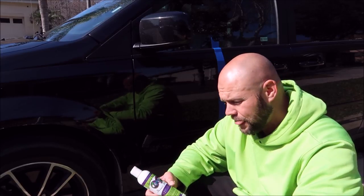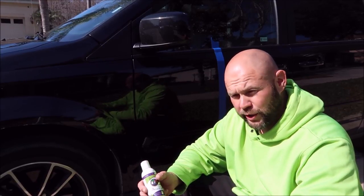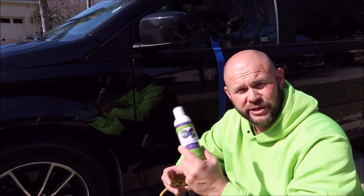It is awesome. Not only will you get decent cut and amazing finish, but you'll also get fantastic, durable, long-term protection out of what's in the bottle. So basically you're just polishing it on. The abrasive in there is a diminishing abrasive, so it breaks down as you use it, creating a better and better finish after every pass. The beauty though is you only need 2 to 3 passes for one 2x2 foot section pass to make it worthwhile.